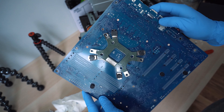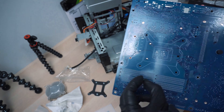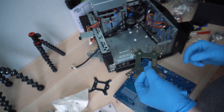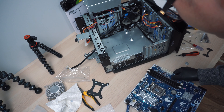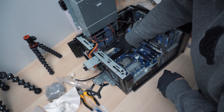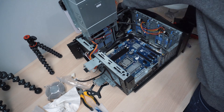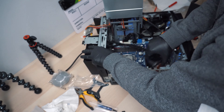To do that we need to unscrew eight screws holding the motherboard to the case. At this point we're basically taking everything out of the case and reinstalling everything back — essentially rebuilding the whole PC system. If you are new to doing this, we really suggest you take a photo before disconnecting all the cables or disassembling any components, so you know which cables go where.